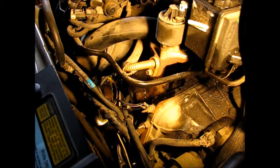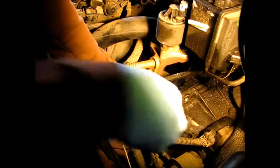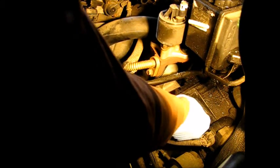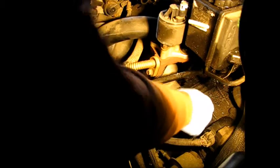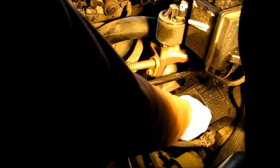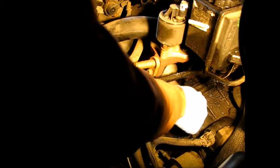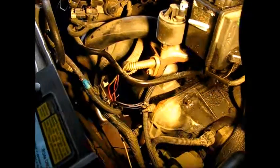I'm going to hoist the starter up from underneath, being careful with the wiring. We were careful to avoid damaging any wiring and now we've got it pretty much in place. The top bolt is just finger tight. The starter's back in and our sensor is back in. Screw the oil filter back on — always just hand tight.